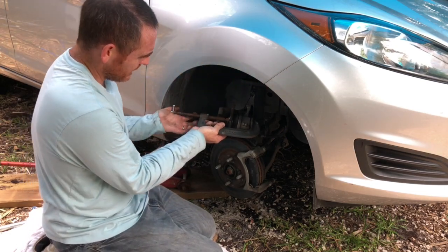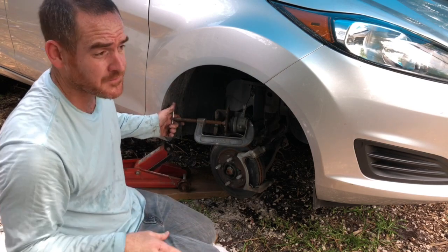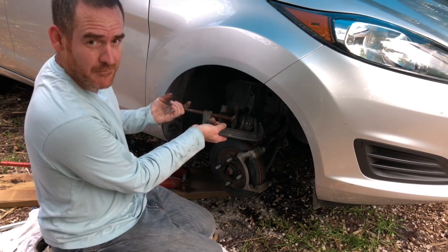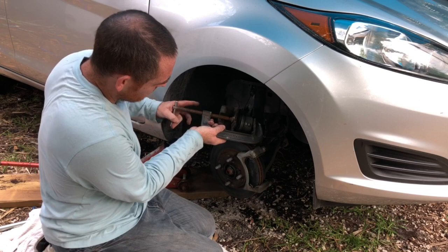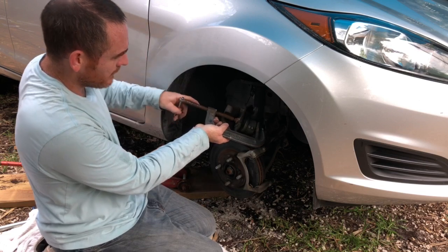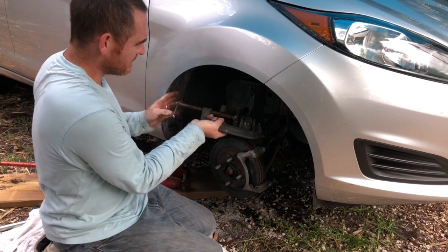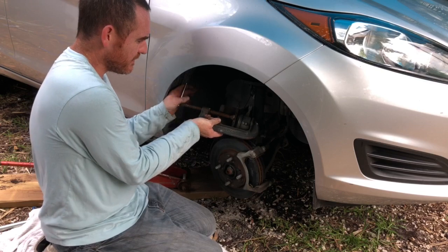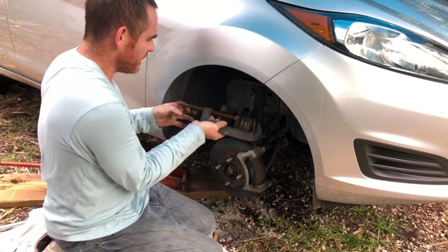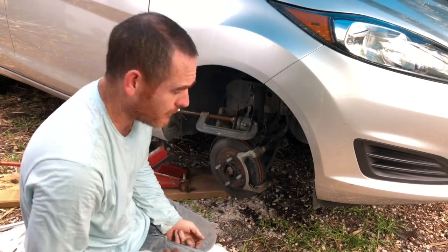Different people may do it different ways — some people might want to bleed the brake fluid. Also be careful: once you put new brakes in, if you just start your car and start driving, your brakes may not work for a second. Just make sure they work good before you take off — maybe use the e-brake, whatever keeps you safe. Okay, it's definitely going in there, which is good. I'm not having to use a ton of pressure but it is forcing in. There we go — it looks like it's all the way pushed in.